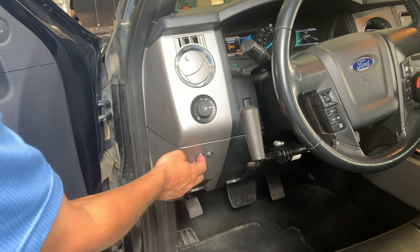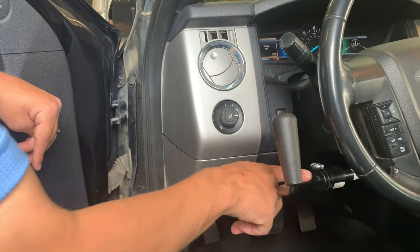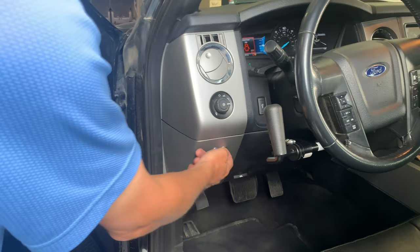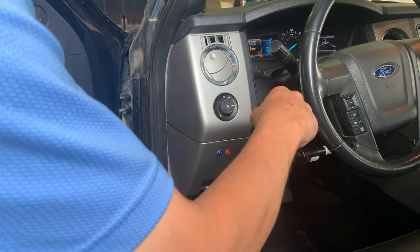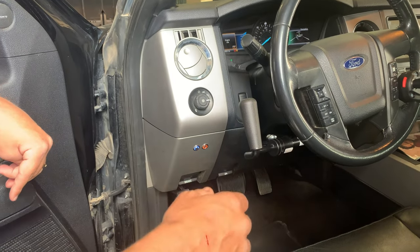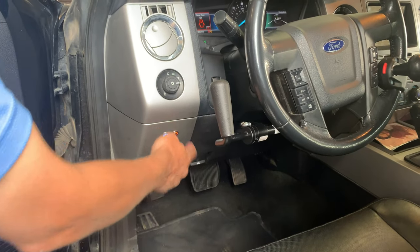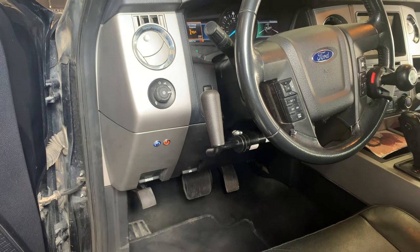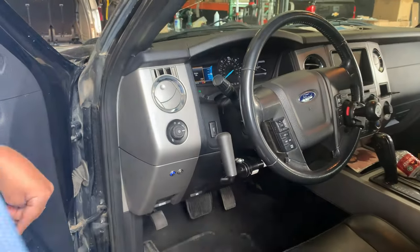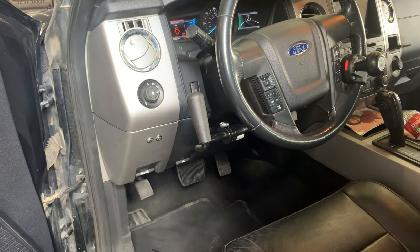Okay. Yep. What's the city button? City button. So from here, obviously we push it down to full throttle. If it's in the city mode, now this at full throttle is half throttle. So it reduces by 50% for city driving, so you're not lunging when you're going. And that city button, you can just press it any time to turn on and off. But if you want to turn the hand controls off, say Meg's going to drive for a while and then you're going to drive, you would just, while the car's running, press this three times. It turns it off.